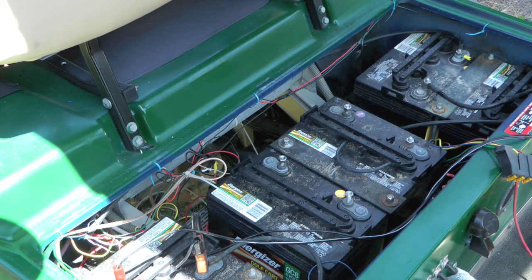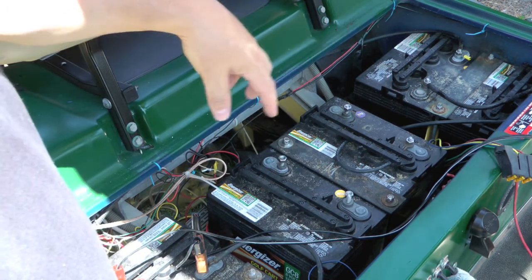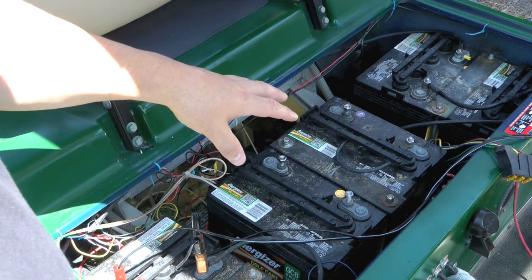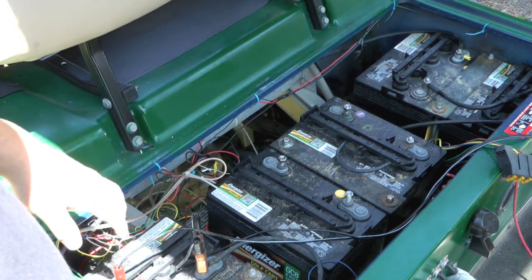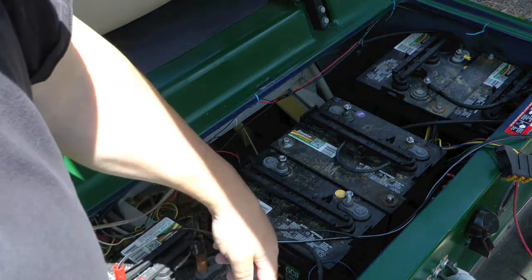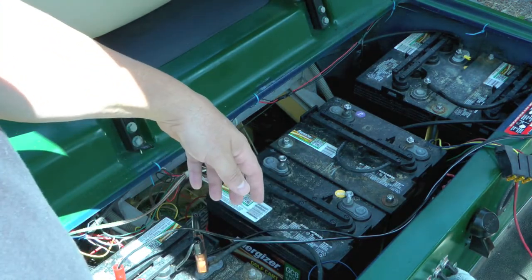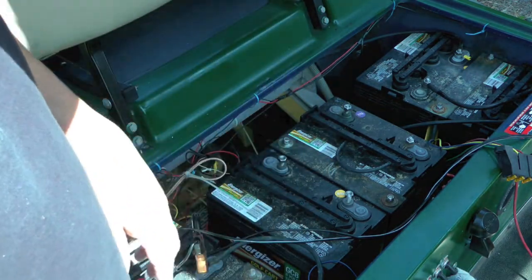So here's a little trick: if you've got a somewhat good battery that will kick on the charger, go ahead and put a charger to it. I've got a six volt battery charger hooked up to one. Now these are eight volt batteries, but don't freak out — a six volt charger puts out close to eight volts, and it's enough to get this charged up to where the golf cart charger will eventually turn on. I got it up to seven volts, then hooked up hot to hot, ground to ground on the dead battery, which lets a little bit trickle over. Put the charger on and it's now charging both batteries. Once you get this going you can either daisy chain it continuously or just move on to the next battery and so on.